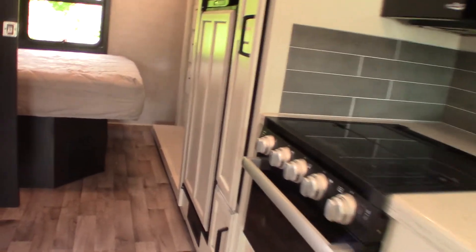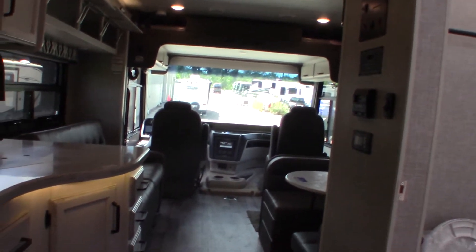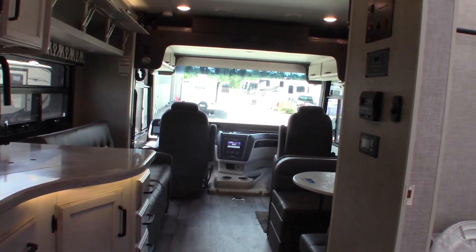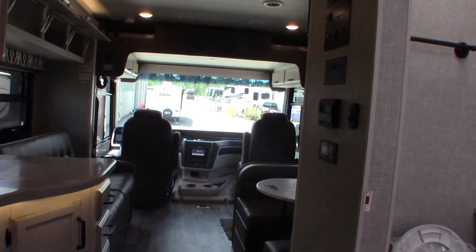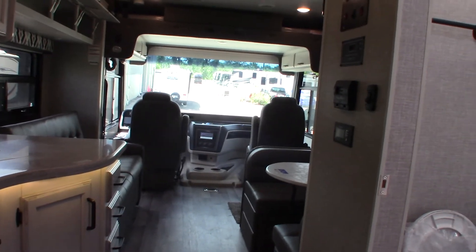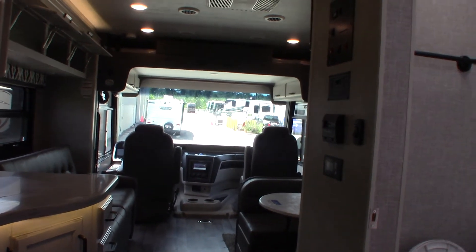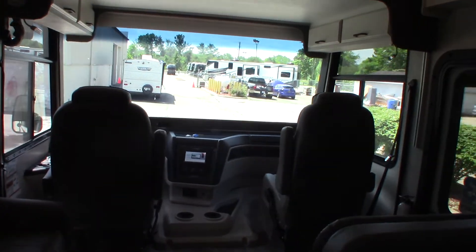Thank you for purchasing your motorhome here at National RV Detroit. Please remember to always inspect your seals and your roof — the manufacturers say every 90 days. Go up there and check every place you see caulk or sealant. Odds are you'll check it for years and not have to do anything, but you're protecting your investment. Also look at the roofing attachments and the roofing material — make sure none of it was damaged by low branches or road debris. This unit has been de-winterized and is in camping mode, so the antifreeze has been purged from the system and it's ready to go. Thank you very much.